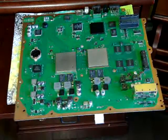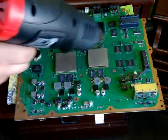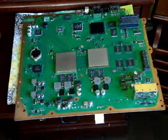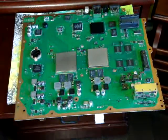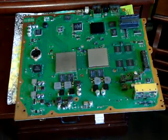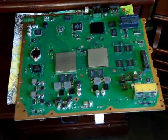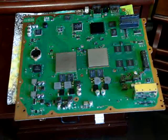What we're going to do — step one — is we're going to heat this whole motherboard up, this entire thing. If you watch the video by Jilkski on YouTube, he only heats up these two chips and these two chips. I've been doing that method three or four times when I got my Yellow Light of Death. I recommend doing the method I'm going to show you, which is much better. When I did it his way, my PS3 lasted about three to four weeks, but with my method it lasted around two to three months.